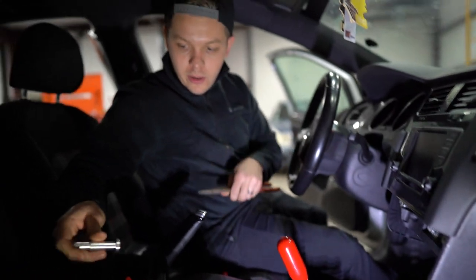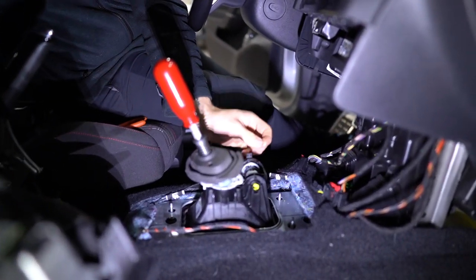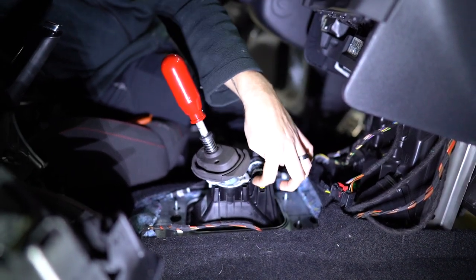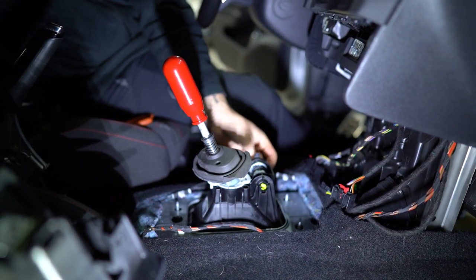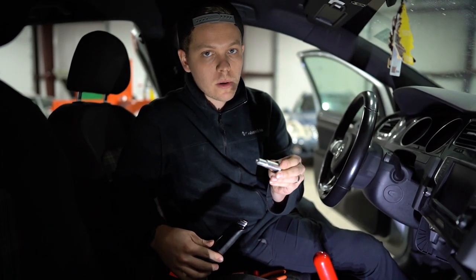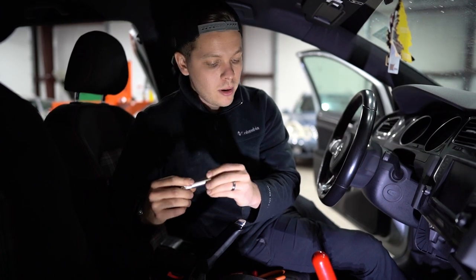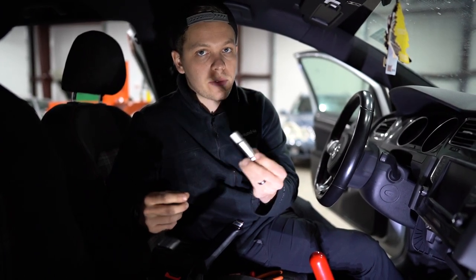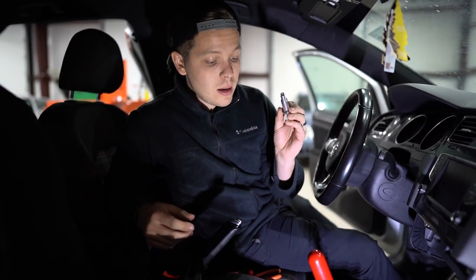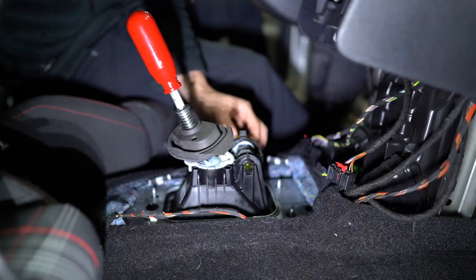We are at the point where we're going to remove the plastic pin. Basically you take a pair of needle nose pliers, clip those in, and it should pull right out. The guys at Diesel Geek did say these things have such tight tolerances that sometimes you might have to take a little bit of very fine sandpaper and just hit it real quick if you have some issues. Let's pop this out and pop the new one in — and add some lube in there.